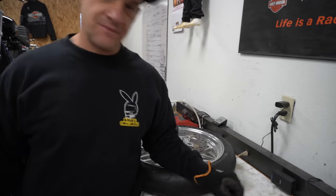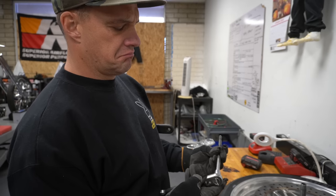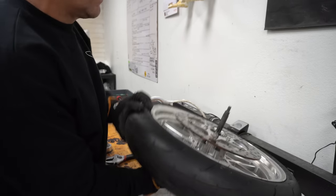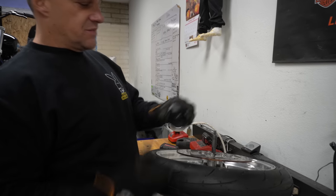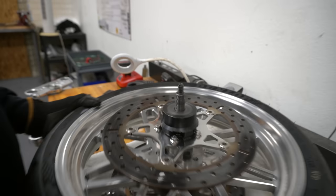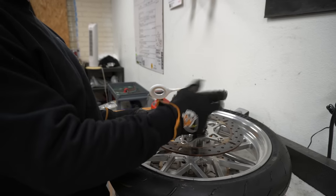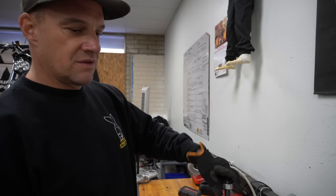This guy right here is the spreader. I got to grab some tools. This is the biggest Allen in my set — three-eighths Allen. She's got it going from the backside up through this guy, just like that. We'll leave that guy sitting there like a little prod. Then this would be the castle something-or-another — she goes over the top, sits down like that. Then you got a big-ass washer that goes over the top. You want to have a little anti-seize on these threads — mine are already loaded up pretty good, but put something on there to keep them from getting cooked. I've found that my nut only goes on one way, and it binds up the other direction.